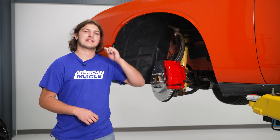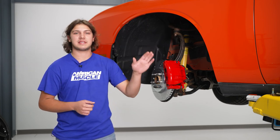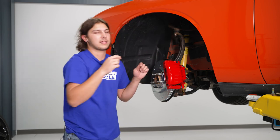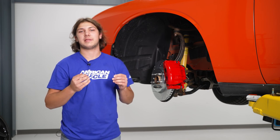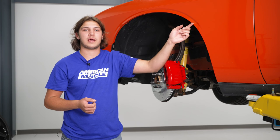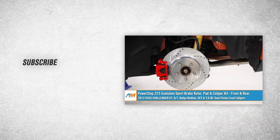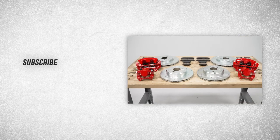Now that your driver's side is complete, repeat that process on the other side. Once that's done, grab a buddy to help you bleed your brake system. Have your buddy in the driver's seat pumping the brake pedal three times, and on the third pump he's going to hold it. While he's doing that, come over and crack your bleeder screw open — make sure you have a solid stream coming out with no air bubbles. The first caliper you're going to start with is the one that's farthest away from the brake cylinder, which is the right rear side, and work your way from farthest to closest. That's going to wrap up the install on the PowerStop Z23 Evolution Sport brake rotor, pad, and caliper kit for the front and rear on your 2012 to 2020 Challenger GT, R/T, Rallye Redline, SXT, and TA with dual piston front calipers. Thanks for watching and for all things Challenger, keep it right here at AmericanMuscle.com.